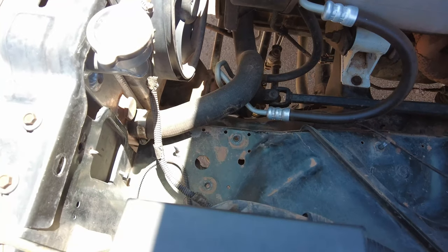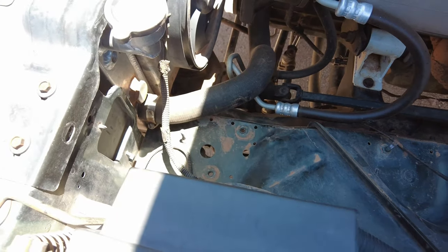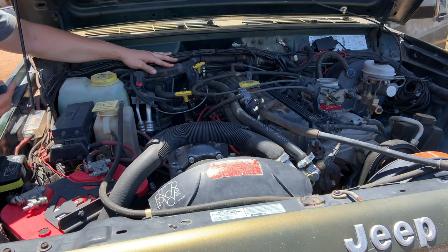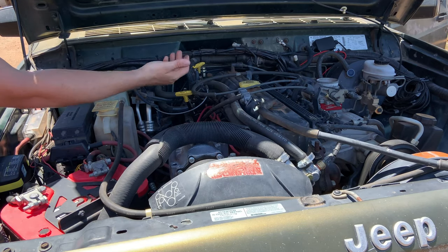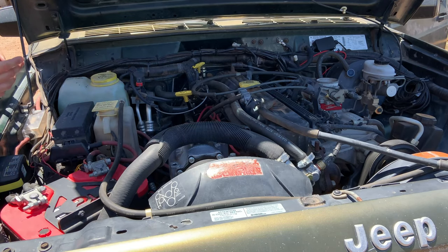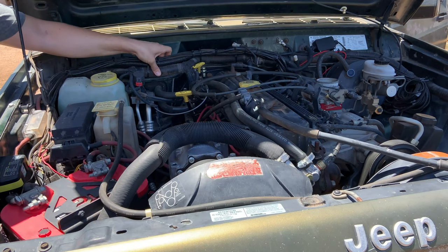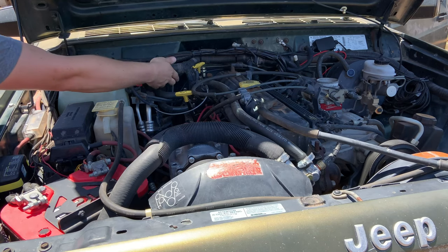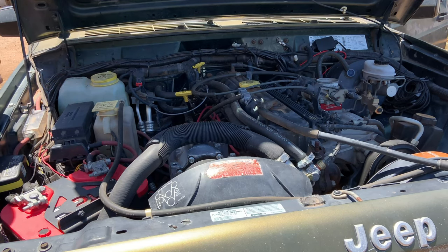If you haven't already, please like the video and subscribe — we really appreciate it. Now it's time to push down the wire harness and mark out where we're going to cut on the cowl. Now that we have the stock air box completely removed, it's time to push down the wire harness and get it out of the way, because the cowl intake will be going in this area. Most Jeeps have their wire harness right on top of that crease on the firewall or below it already, so your life should be easier. I have extra wiring for my lights and my secondary battery zip-tied to my wire harness, so I'll cut all those zip ties, get everything out of the way, and push this harness down below where the bracket will go.